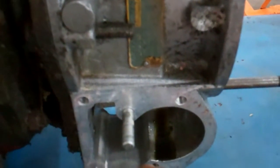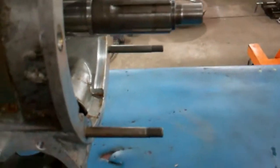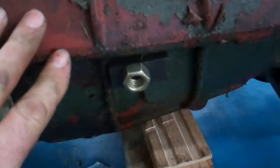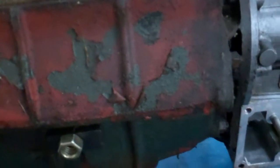When you look in the manual, an E-type Moss gearbox four-speed without the overdrive is one and a half quarts. Well, that ain't gonna cut it when you have to fill this whole overdrive assembly. With an overdrive unit on it, it's supposed to be 2.25 liter or 2.38 quarts. So the dipstick and fill hole are designed and marked for a non-overdrive — they're useless when it's an overdrive transmission. That's my two cents.